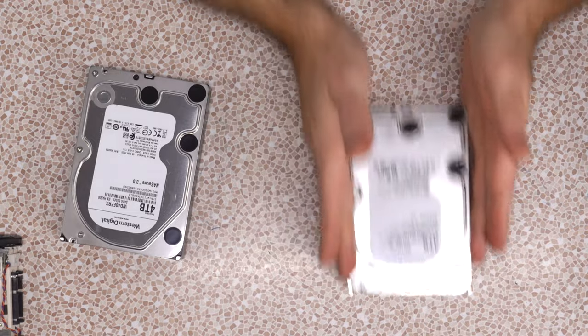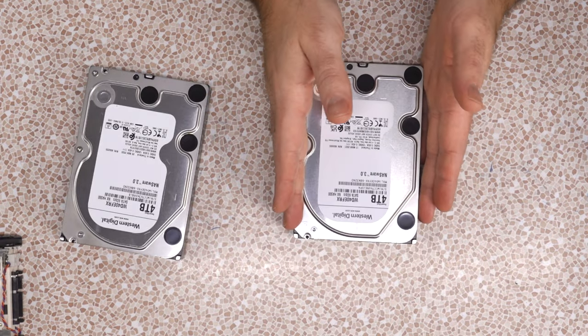A tape, it sits on a shelf and nothing happens to it. Keep it warm, keep it dry, keep it away from electromagnetic radiation, and it's good for 30 years. And as long as I can get my hands on a tape drive that can read it, I'll be able to recover my data. At some point, when I'm done processing the data that's stored on this and made finished projects, well, I'll just rewrite over that tape and I'll cycle this process, I guess, until the tape wears out.